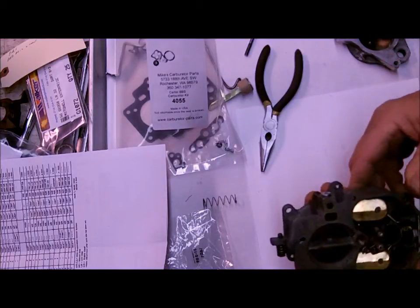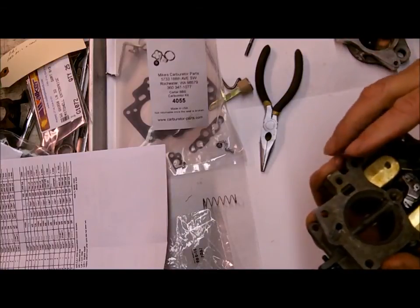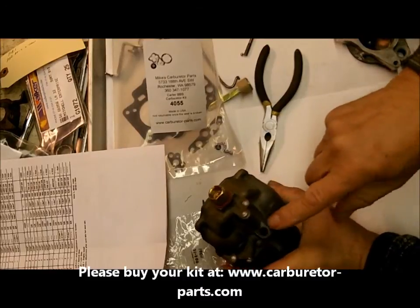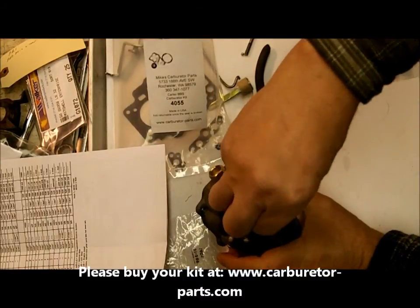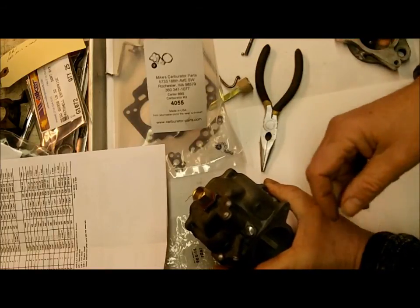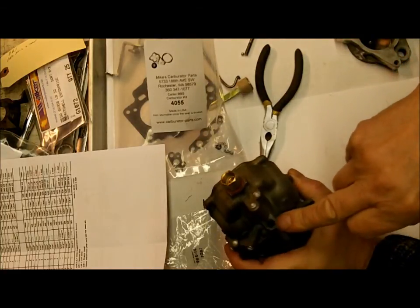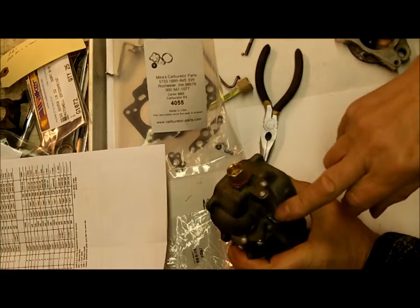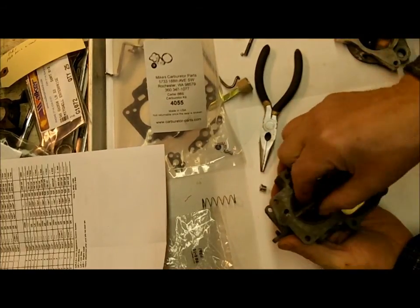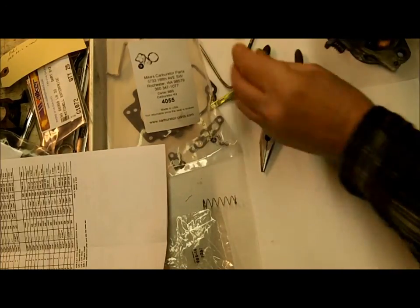All right, so, okay, you can also hit this with a hammer. And your other one, which I take out to clean, goes down in here, like so. It fits a little tighter. Anyway, there's a little needle down in there. Don't try to take it out. Leave it alone. Just make sure it's clean. Blow it out. You should get air from there up to these two little nozzles up here in your Venturi. And that's the name of that tune.